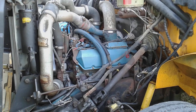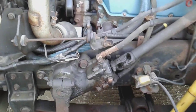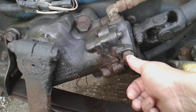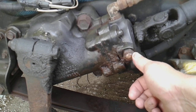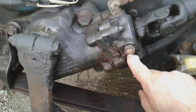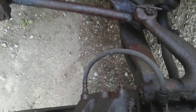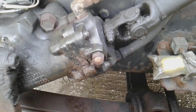Look at that nice clean engine. I had a power steering leak — I couldn't figure out if it was a line or the power steering box itself. It turns out if you thread out this fitting here, there is a poppet and a spring inside. I couldn't find a replacement, so I took it to work and my buddy welded it right there. The metal was really thin and a pinhole formed — every time I turned the steering wheel a little fluid would shoot out, squirting on my brakes and down on the axle. At least that's now fixed and we don't have to worry about the power steering leak anymore.